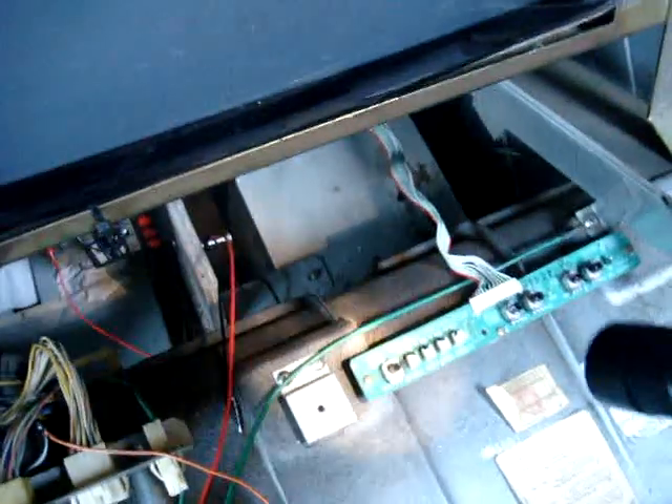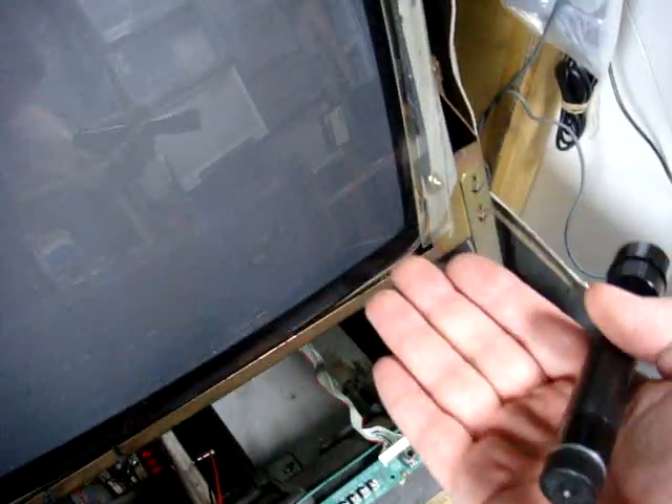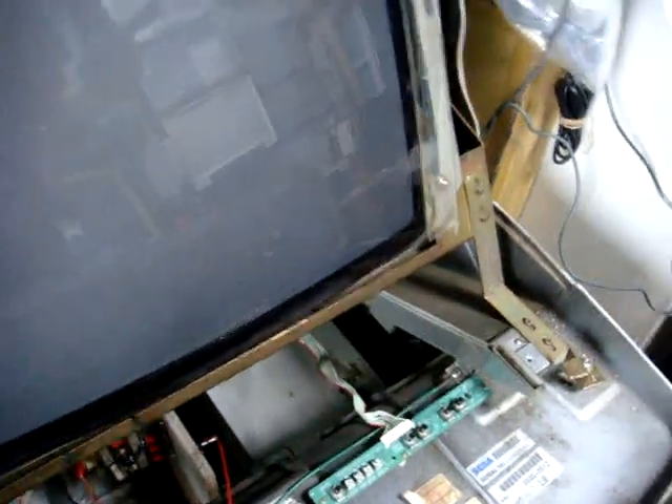When the monitor is in the horizontal position, you can look behind here and see the screw that's holding the rail on. That's holding the one rail on, and then the other screw right there will be holding the other rail on, so you can take it off a lot easier. You might have to crawl up underneath here and go from the bottom with the screwdriver to get it undone. Once you get that rail removed while it's still in the horizontal position, then you're set and ready to go.